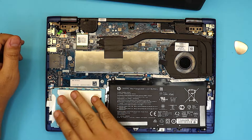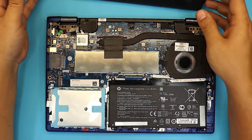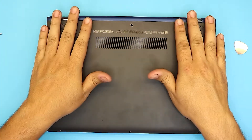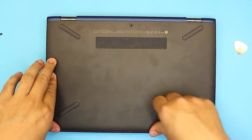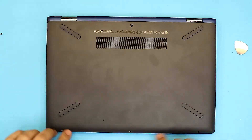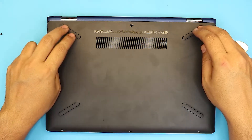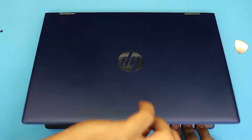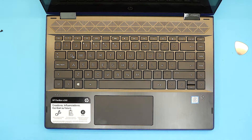I just put the original hard drive back in as a demonstration, so I'm not actually going to change the hard drive on this one. That's the way you should be changing your hard drive. Next, grab the bottom cover, place it straight on top, and squeeze — put pressure right on the edges and corners. Then put the three screws on the bottom side, one on the top, and one under each rubber foot. I hope you guys liked this video — if you did, click the thumbs up button. Leave any requests in the comments and I'll answer them as soon as I can. Thanks for watching, see you in the next video!